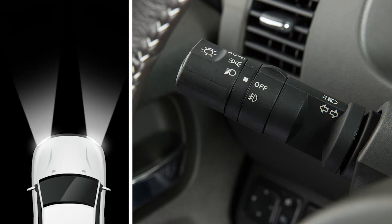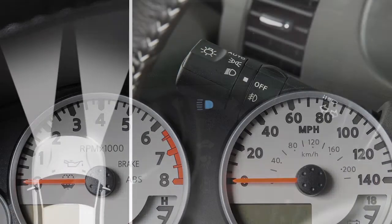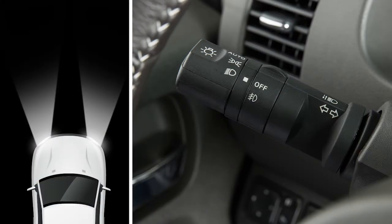All the other lights will stay on. To turn on your high beam headlights, push this lever forward. You'll see a blue indicator light illuminate. Pull it back towards you to return to low beam. The blue indicator light will turn off. To make your high beam headlights flash on and off, pull the lever towards you and release it.